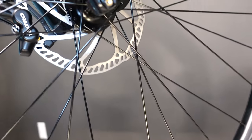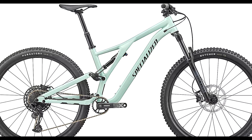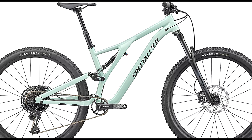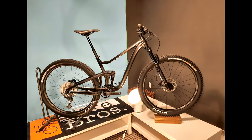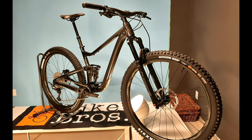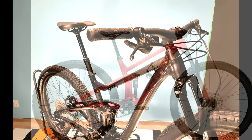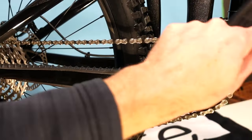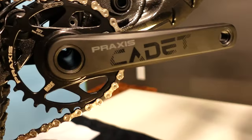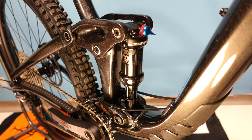There are two main comparable bikes I see from Specialized and Trek. From Specialized is the Stumpjumper Alloy — a $3,599 bike with 130-140mm travel — which is more expensive and lower spec on every major item: front and rear suspension, drivetrain, and tubed smaller tires. The only equivalent part is the brakes, which is ironically the one weakness on the Trance 29 II. From Trek is the Top Fuel 5 — once again a more expensive 120mm front and rear travel bike. The Trek has down-spec suspension and the same drivetrain and even cheaper brakes. It does have down tube storage, which is really cool, but I wouldn't trade away the Fox DPS on the Giant to get down tube storage with an X-Fusion rear shock. The X-Fusion just will not feel that good.